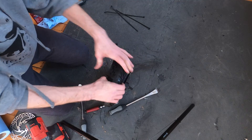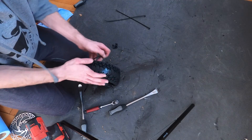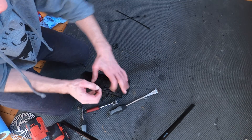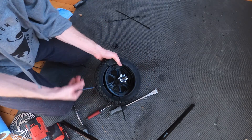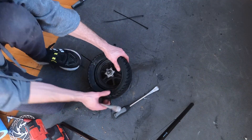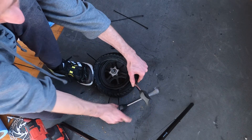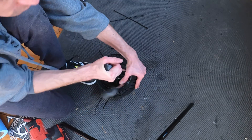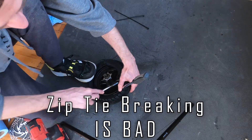I try to do at least three to four zip ties minimum — spread them out. Sometimes zip ties will snap from how much pressure you put on the tire. The concept is the tire is going to sit and sink inside there with the zip ties. Put your foot here, put the first tire iron in — see how it kind of slapped around there, that's the trick. Just keep working with the tire irons.